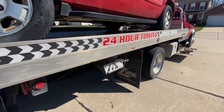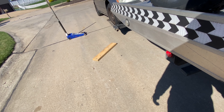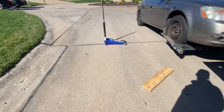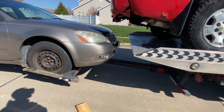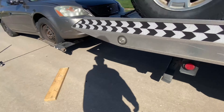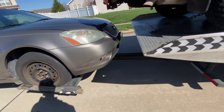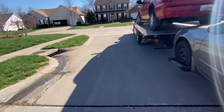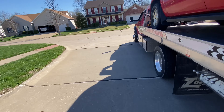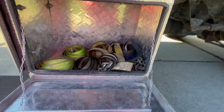Go ahead and raise her up. You want the headlights kind of just barely poking over — I've always had luck with them like that, never scratch anything or damage anything. And that's pretty much it. I can show you guys how to do the straps real quick. You should have a tow light to put on the back — when you're in tandem you always should have some kind of indicators, flashing lights or what not. And then I'm going to take the strap.